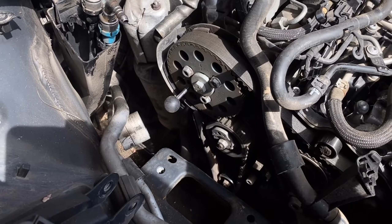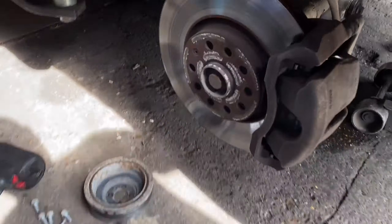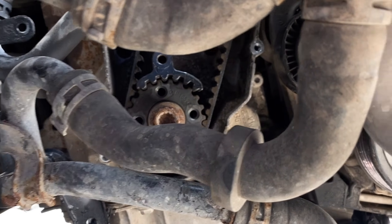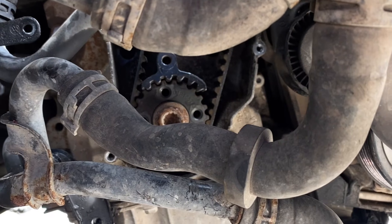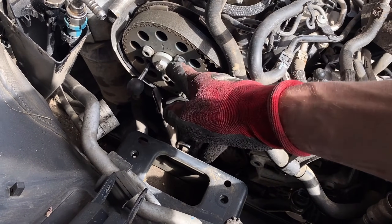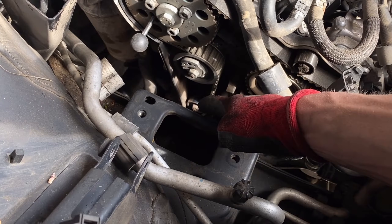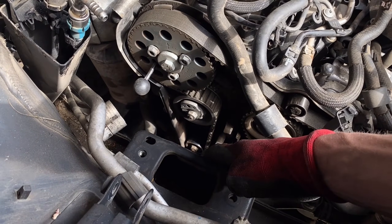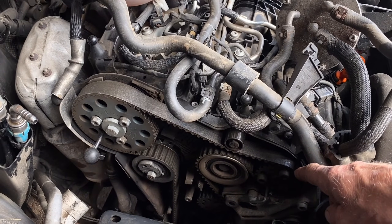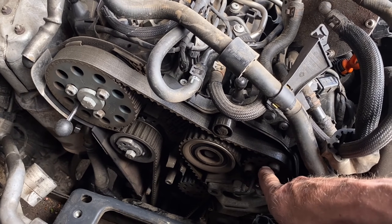Put the crank tool in and put the top cam locator tool in — it's sometimes a bit of a squeeze. I've ever so slightly chamfered the edge on my pin but it does go in. You can see both locators are lined up. Tap the tool in with a hammer and tap it out once the new belt is on. Back to getting the belt off — with the locators in, I'm going to crack the cam bolts off with a 13mm. You can mark them if unsure as the pulley elongates. There's also a 15mm spanner on the tensioner and a 30mm nut on the bottom roller. Regarding the injection pump — there is a hole for a pin but this one's slightly off, so I've used a smaller pin that does fit, and marked the pump with silver paint so I know the position.